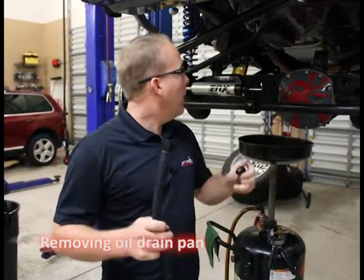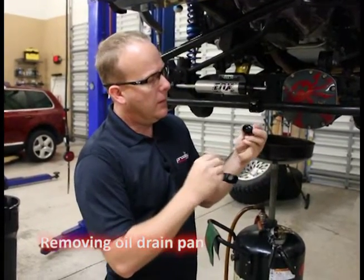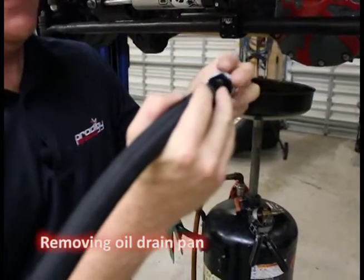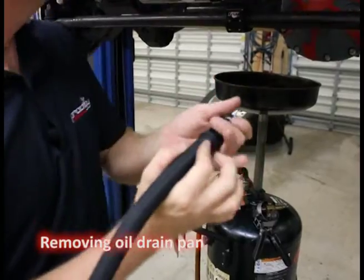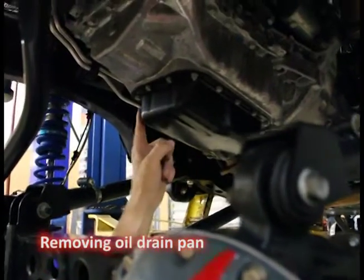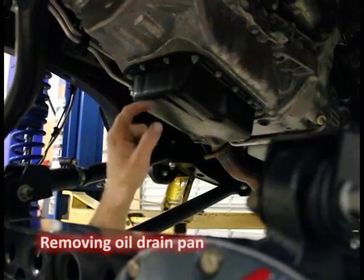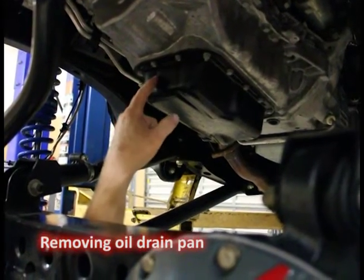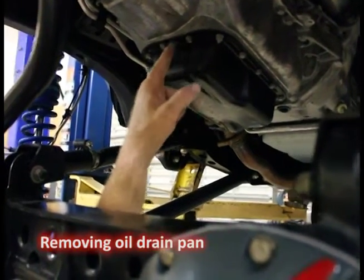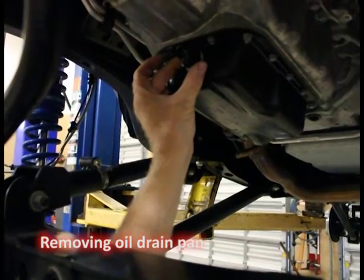So at this point we're going to remove the oil pan to install this fitting — an AN fitting — so that we can attach our turbocharger drain hose to it. The oil pan on this vehicle is excellent, it's very simple, just these 10mm bolts all around the outside. You gently pry it down. When we're drilling the hole, we're going to make sure we don't drill it in front of a bolt — you want a nice spot between the bolts so when it's finally installed it will be down the middle.